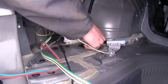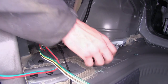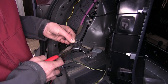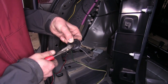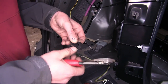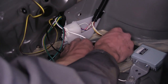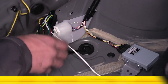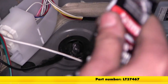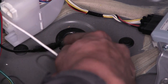Now this grommet right here — we'll grab it and pull it on out and use it to pass our wire through. Take our black wire and pass it through the hole where the grommet was. Now we'll take our grommet and put a slice in it. Once we have it cut, come about 90 degrees and make another notch in it so we'll give our wire room to pass through. Slide our wire through it and reinstall the grommet. With the grommet back in place, we can seal it up with some silicone sealant. This will keep any moisture or exhaust gases from entering our vehicle. Once we have a nice dab in there, we'll push it down in where we cut, and this will seal it all up nicely.